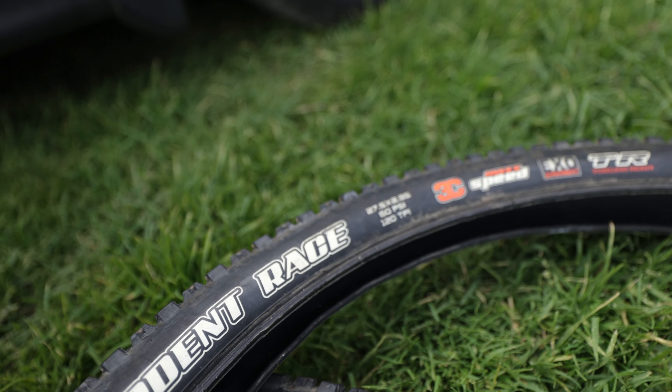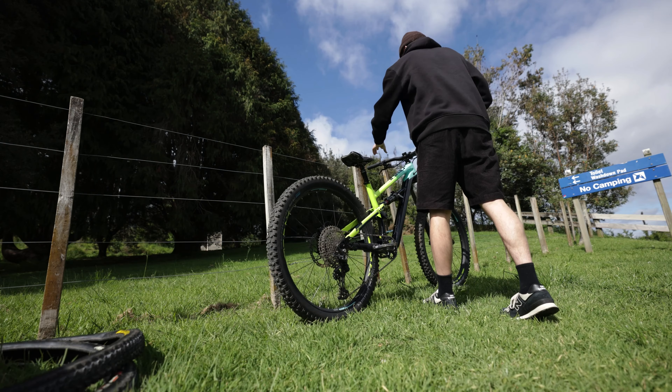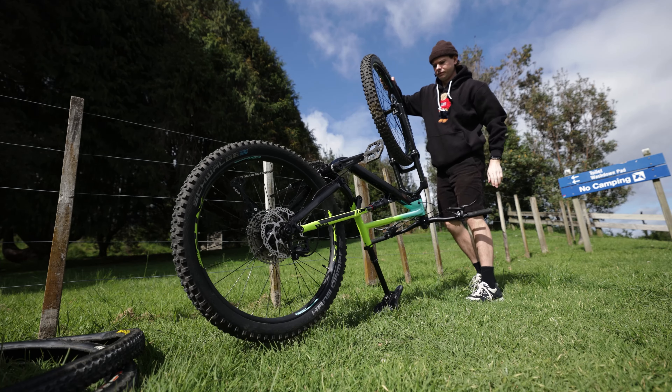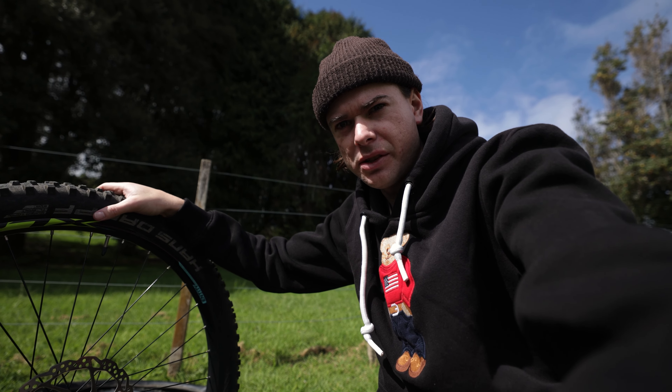So let me run you through what we need to do. First thing, we've got to change the tires to a more race-suited compound, because these trail tires that are on are a bit too wide and have too much rolling resistance for what I want. This course is an urban course, so there's going to be a lot of concrete and stuff. Switching over to some Maxxis tires — I got the Ardent Race. These are secondhand tires I found up in the ceiling at my parents' place, so good to get some freebies. It's probably gonna transform the bike to more of an XC style.